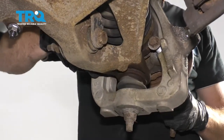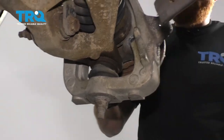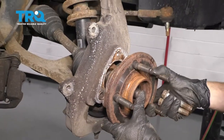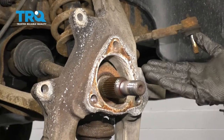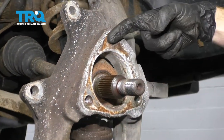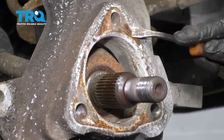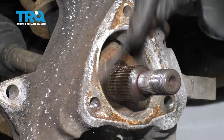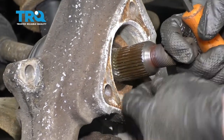Looking at the backside of the knuckle along where the axle connects into it, you're going to see three mounting bolts for the wheel bearing itself — there's one here, one on top, and then one towards the front. Remove all three and pull those bolts out. Now we can come up here and grab this bearing. Now that the bearing's off, there's something we need to pay attention to: all the corrosion along the area right here. You need to scrape that off — you don't want anything left on there. Use a nice scraper or a chisel, or whatever you have, maybe even a nice brush.